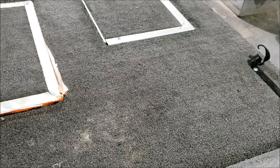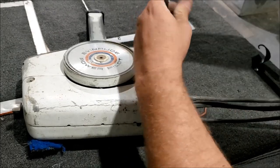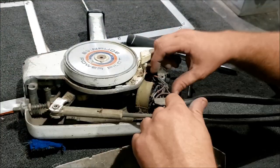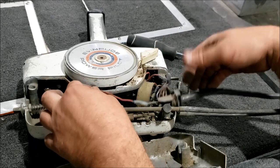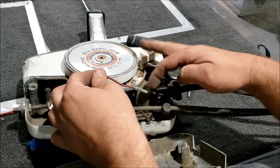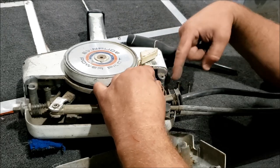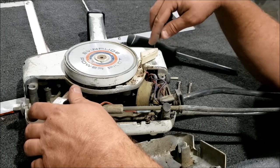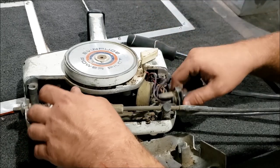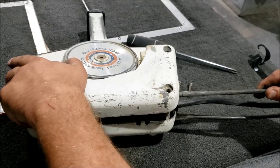If you have a power pilot controller, let's pop this cover off. You can see bundles of wires, and in this bundle is what remains of a gray wire - that's your tachometer signal. Purple with white is your choke or primer - don't use that. Here is your purple and your black. You could take the top half of the controller apart, tap into the purple and black wire with a ring terminal, or power it elsewhere.